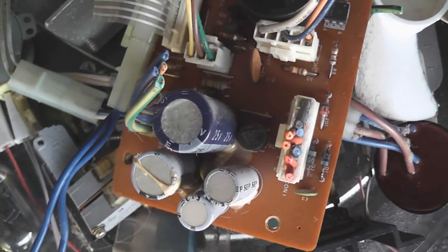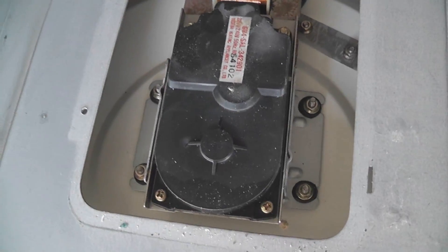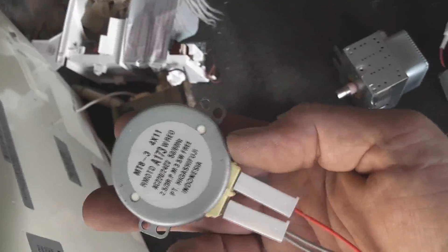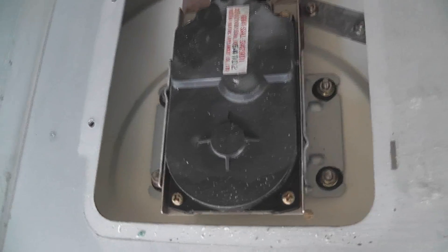Classic Philips logo. Interesting old resistor on the base and another round cylinder thing — timer boards I may have no use for, but it's got tantalum capacitors, which is quite cool. There's a capsule buzzer type thing, a small transformer, and this is quite interesting — a discrete shaded pole motor with an open gearbox for the drive, instead of the little micro motors you see in more modern microwaves.